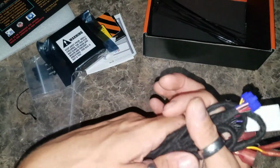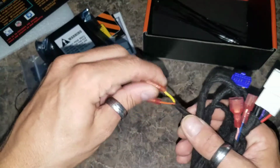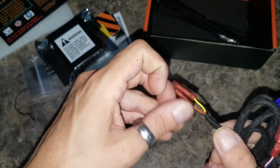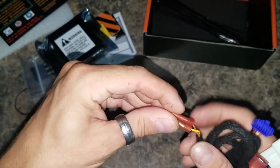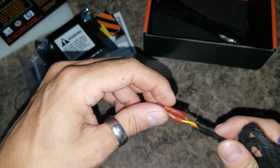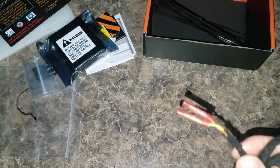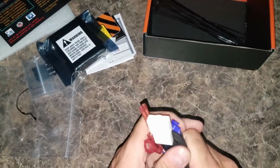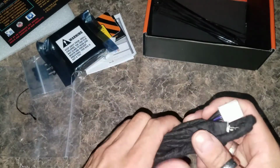So our plug and play version will obviously be 100% plug and play. The funky part is where these tap into in the Camry. It's no longer a 20-pin plug like a normal Toyota headlight switch. Now it's a multi-function connector which carries your steering sensor, your wipers, your headlights. It's a 40 or 41-pin connector. Nobody has it. We're having to build a mold for it, as well as a BCM connector. So it's going to be some time. It's probably going to be mid next year, honestly, before we get the actual full plug and play 2.1 kit.